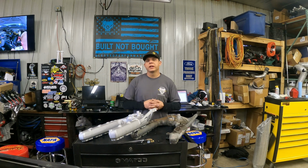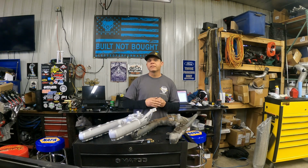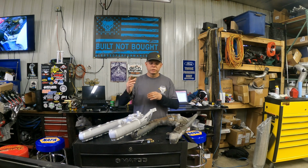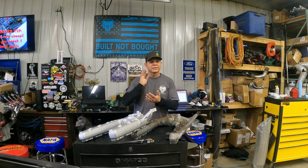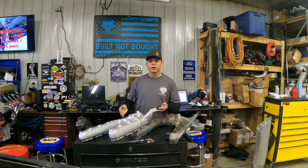Imagine you're towing your 30-foot camper up a mountain, you see 1,300, 1,400-degree EGTs. Take 150 degrees off that. At 1,300, 1,350, you start to back out of it. Well, now you install this bad boy and you're only seeing 1,150 to 1,200. Right then and there, you can stay into it while you're pulling that same mountain, not have to drop down in power, which is awesome.